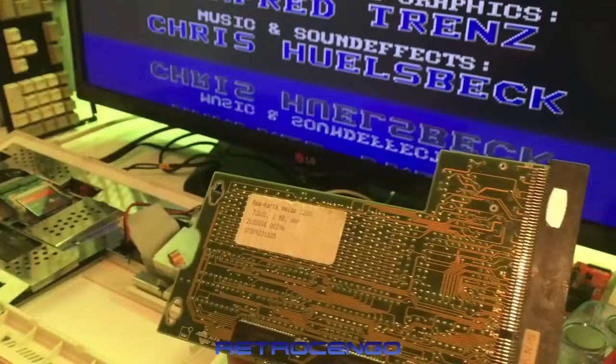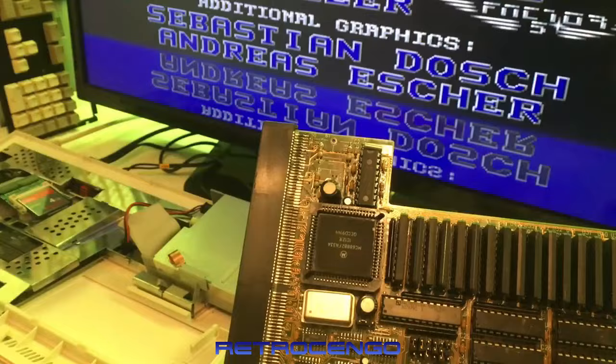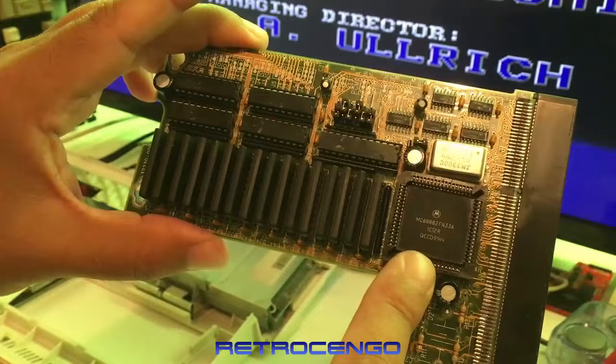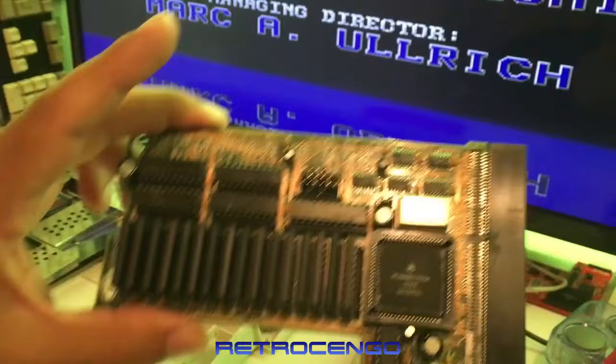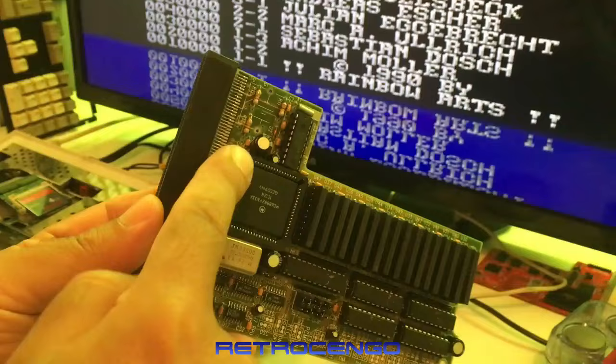And at the front here, as you can see, the battery has been removed and it has got some repair job up here. Other than that, if you turn around over here, it's got the FPU 68882 33N. So it's got a 33 megahertz FPU. That's nice. That was maybe also optional. Sometimes you could buy these cards without the chip here. It had an empty socket, so maybe it's an upgrade, I don't know.